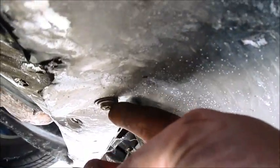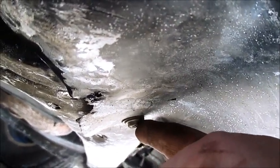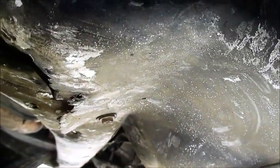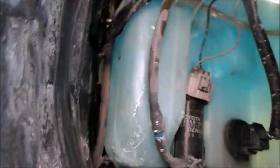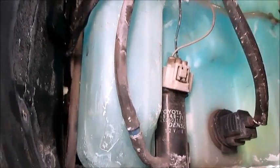This last one has a rubber gasket that the cover stays attached to. If you need a lot of room you can pull that cover off, but it's kind of a bear getting it back on. Anyway, it was a pretty easy fix. It's probably not a broken pump — just get a hairdryer or heat source in there and unfreeze the pumps. If you can't wait, put it out in the sun and wait for a warm day. All right, take care.